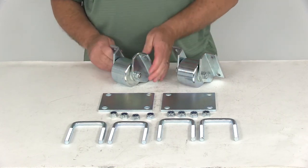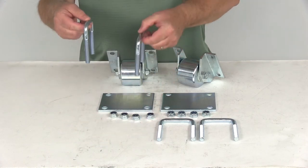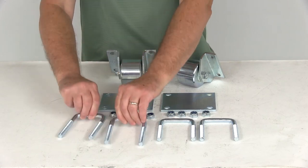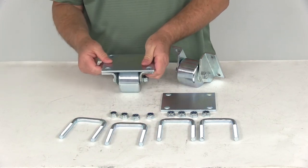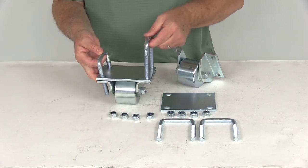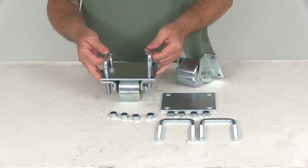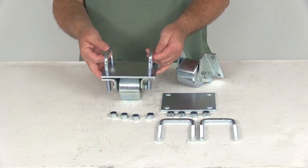When you go to install these, you'll start on one side of the hitch and drop these U-bolts right over the top of your hitch tube. With those hanging down, take your mounting plate, put it on top of your rollers, and line those up so the U-bolts come right down through there. This will be mounted around your square hitch tube, and then using the lock nuts, you'll put the lock nuts on and tighten it down to correct specs.